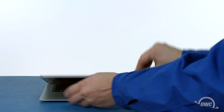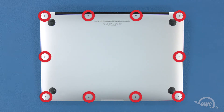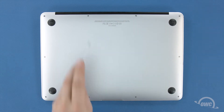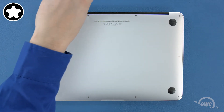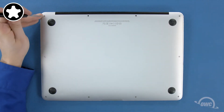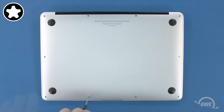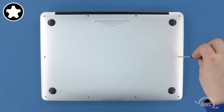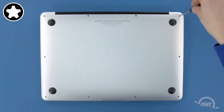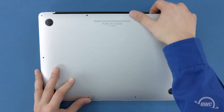The first thing to do is close your MacBook Air and flip it over. On the bottom are 10 5-point Torx screws to remove using your pentalobe screwdriver. The two center screws along the hinge edge are longer than the others, so let's remove those first. You can now lift the bottom cover up and off. There's a snap underneath near the center so you may have to pull a bit to detach it.